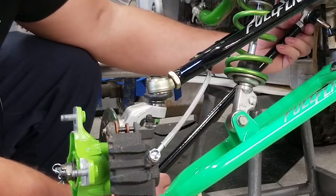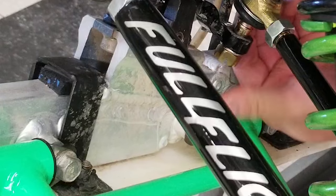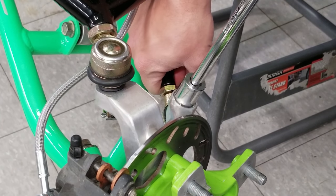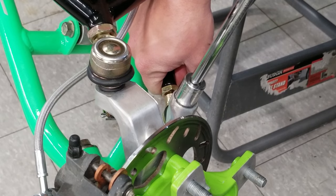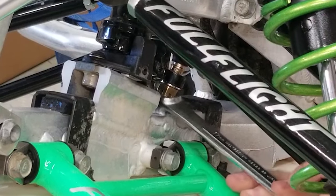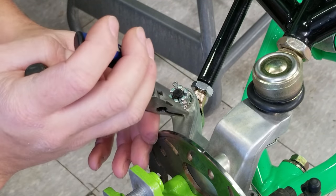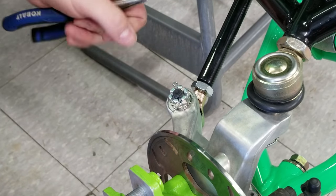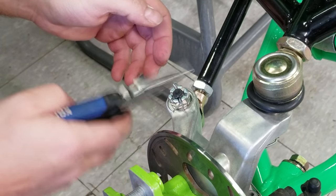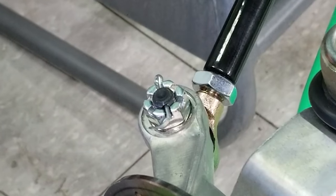Put them in place, throw a washer and our castle nut on, same thing up here. I'll tighten these down with an impact but if you want to torque them they go to 27 foot pounds. Sometimes you've got to put a little pressure on them so they don't spin - the ones on the inside can be a little tricky to get to, especially on the KFX. Of course, don't forget to throw your cotter pins in. I like to angle these with the end facing towards the side that'll be easy to remove - take your dykes and pull from the easy side. I hate cotter pins as it is, so make it as easy as you can.